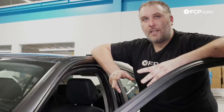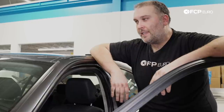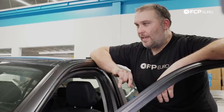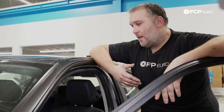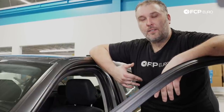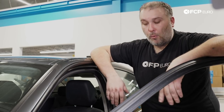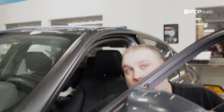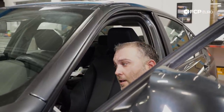So we hooked everything back up in the engine bay, all the connectors, nothing's left over on that end. So we vacuum filled the cooling system, but we still wanna bleed the cooling system out, and all of these external water pump cars have that feature built in. It's very simple: you turn the car on into accessory mode, put your heat on full max, fan speed setting low, and then hold the accelerator pedal down for 10 to 12 seconds and the water pump will kick on. It runs for about 8 to 10 minutes, but it will fully bleed out the cooling system without having to run the car. It's a pretty nice feature that's built into these cars.